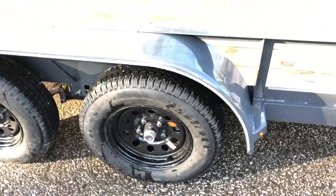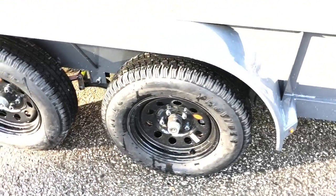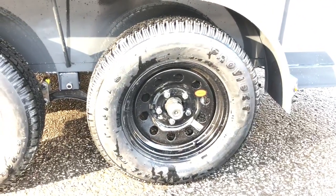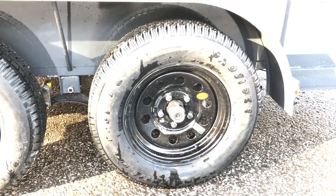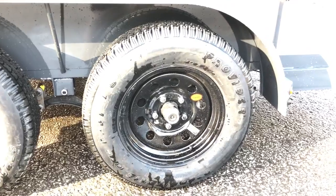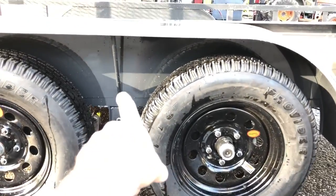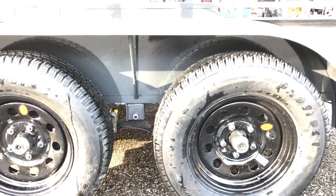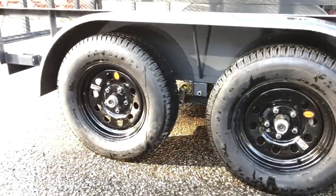You'll notice it's got fender support both up front and behind. Radial tires are standard — a 205/75 R15 load range C six-ply tire. The fender supports also mean that if somebody were to sit on a fender or apply similar pressure, it's not going to crush the fender.